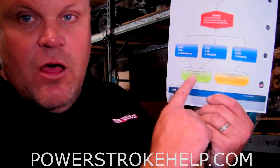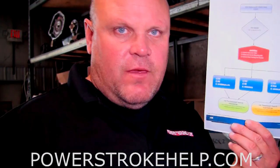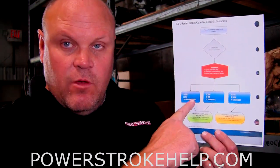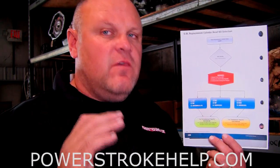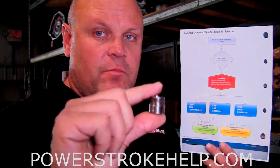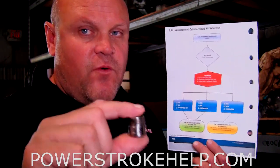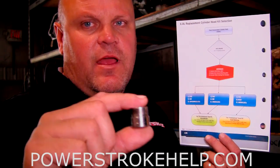It boils down to what they call a pre-commonized head and a commonized head. Now once you look at this sheet, I'm going to start with the back side first. Let's start with the casting numbers because the casting number is really the most important part. All of your 080 C1 through C4s are all compatible — they use the same rocker boxes, the same injector hold downs and so on. Where it starts to get sticky is when we deal with the 20 millimeter heads, which is the 613 C1s. Both of the 20 millimeter heads can be used on an 18 millimeter block with the step-down, which comes with the head gaskets from Ford because they know there are a bunch of different heads on a bunch of different blocks.